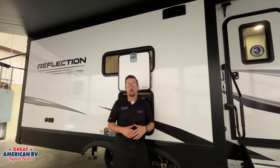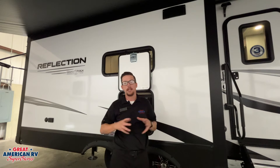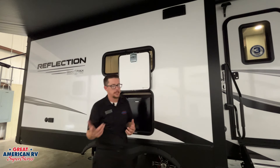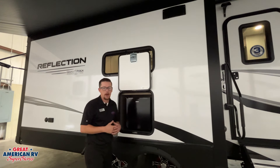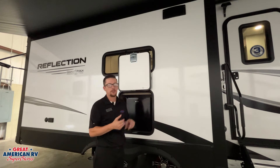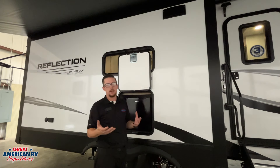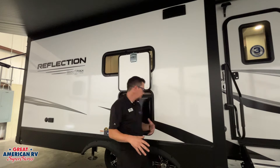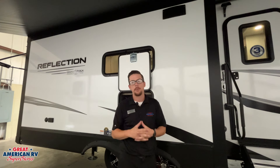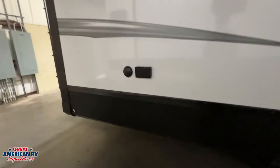Under our awning you'll see a vent on top of that slide out — that's for our hood range over our cooktop in order to ventilate it outside. There are two tabs on there — make sure they're open so it will actually ventilate. You can close it when storing to keep rodents from building nests. We also have a 110-power dorm fridge outside for drinks. Anytime we unplug our system we need to come defrost this unit and get all condensation and standing water out of it. If we don't, that water can leak out and damage our wood components — this is customer maintenance.